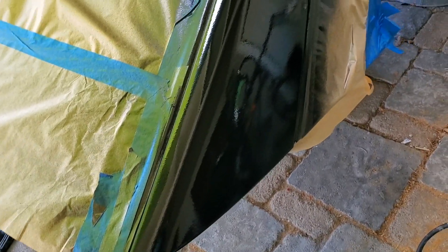Here we have the result after our first coat, and it's just got a colossal amount of orange peel. There are some other little pockmarks in the paint, but the level of orange peel is just huge. It's like it's not atomizing enough or something, because there is no way I'm ready to paint the car — I do not want that kind of surface. I'm letting this flash for about 10 minutes and then I'm going to put a second coat on, which is what the instructions call for. But I really doubt there will be much more flow-out. I'm going to have to screw around with the gun a little more.